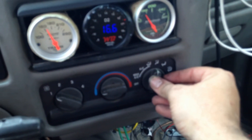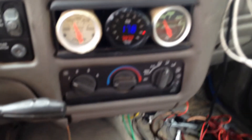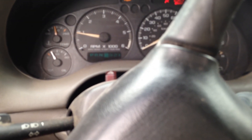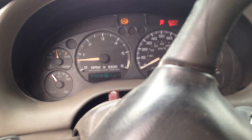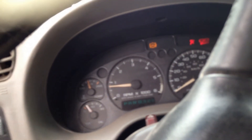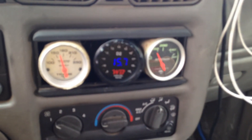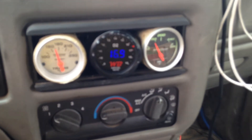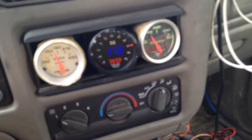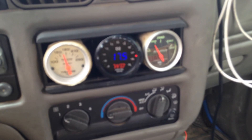What I did was go into HP Tuners and raise my commanded idle in gear with the AC on — I set that to a thousand RPM. So when I'm off-roading and I don't want to push the gas and I just want that little bit of extra RPM for crawling, that's perfect. I have a 1200 to 1400 stall torque converter so it engages really low — I can't really stall it or rev it high and launch. I'll guess the exhaust leaks are keeping this from reading true. I did calibrate it open air first. These videos are looking really really shitty — this phone has to go.